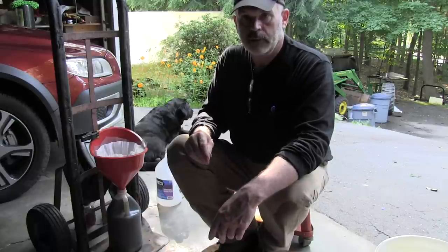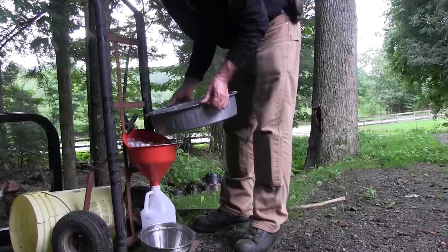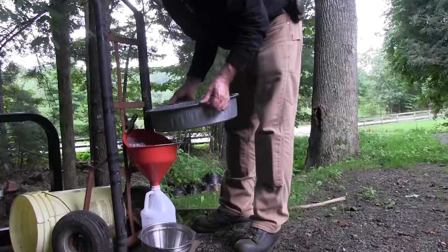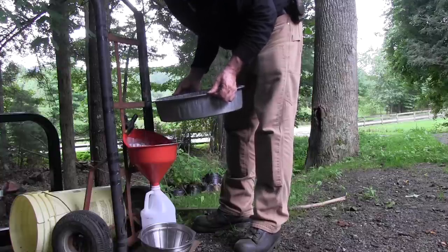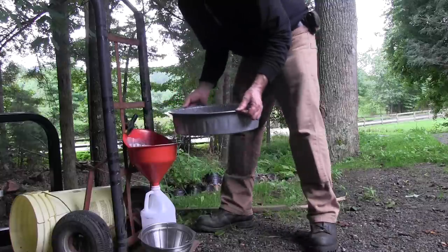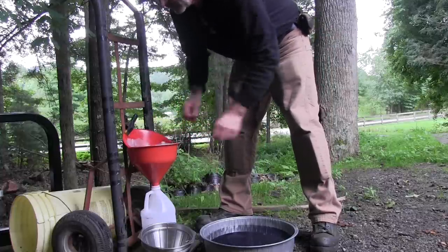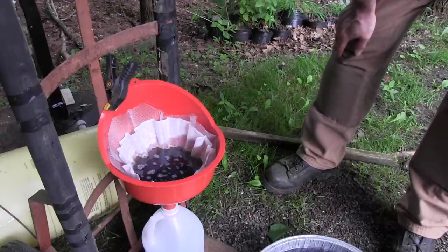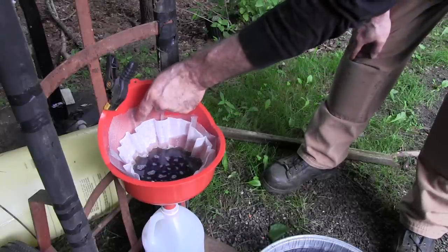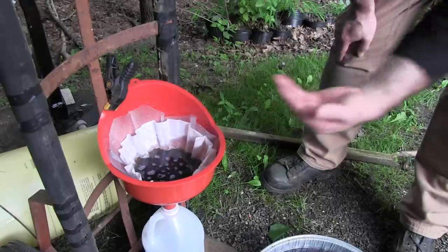You put your filter in there and then pour your oil in. I have some footage I made earlier without the microphone on — I'll show you that. I'm pouring oil through the filter. I had taken great pains to make sure the pan was clean, wiping it out with brake cleaner, but there's still going to be debris in it. Here I'm explaining how the basket keeps the paper filter from plastering to the funnel and allows it to drain over the entire surface of the paper. Without the wire mesh or some kind of basket, the filter just wouldn't work.